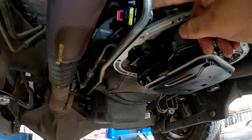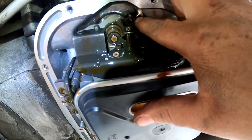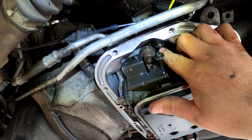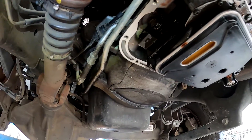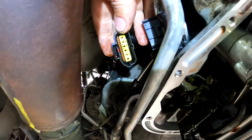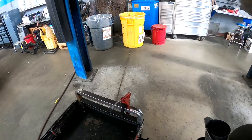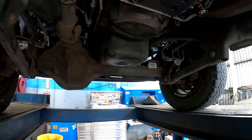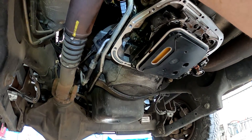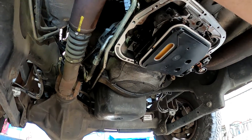We already went through and replaced the neutral safety switch. I like to do that now so I can verify that the neutral safety switch is engaged where it needs to be on the shifter, on the manual valve. I've also gone through and I'm in the process of cleaning out the connector — using contact cleaner and a little rubber-tip air nozzle to clean it out the best I can. Oil, or in this case automatic transmission fluid, can get into the harness and build up resistance on the circuit and cause issues.